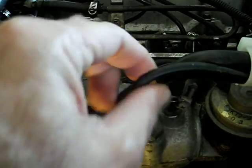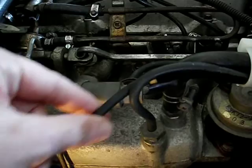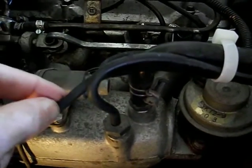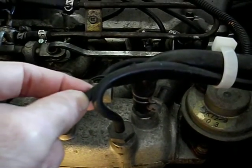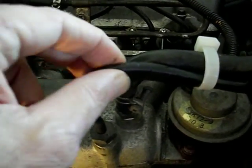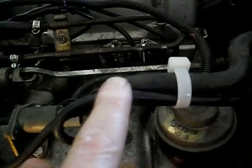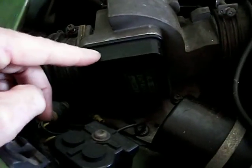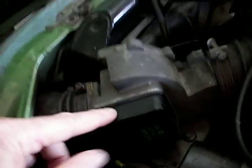I cleaned up this area right in here where I had previously used a connector to join this vacuum hose. What I did was use a small brass tube stuck between where it was cracked, then put some heat shrink around that to make it neater, tighter, and less likely to continue cracking the fragile tube buried inside the wiring harness. I also got rid of the tie wrap and properly sealed this with some silicone safe sealer, so that's all nice and snugged up now.